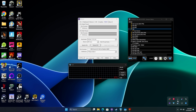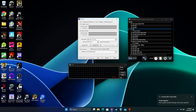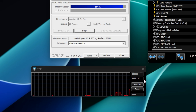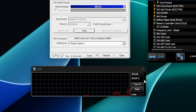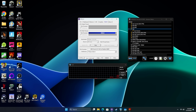For this, I use a third-party application known as the x86 tuning utility. I've already got a preset. When I stress the CPU, we'll see this jump up to close to 90 watts. So we're right there at 90 watts — that's quite a bit for a mini PC like this. I've been up and running for about an hour and 40 minutes with it and haven't run into any crashes. We're getting a huge boost in performance on the CPU and GPU with this overclock.